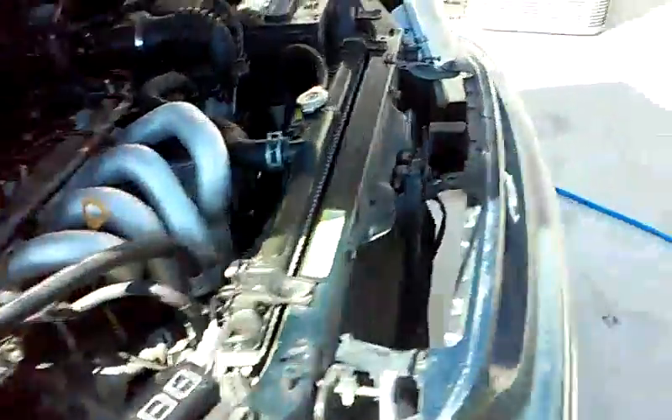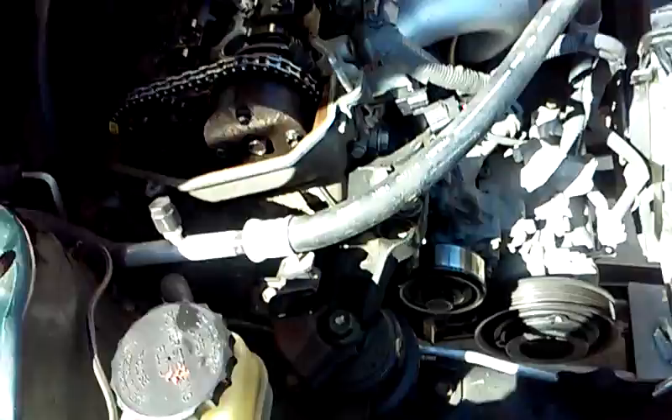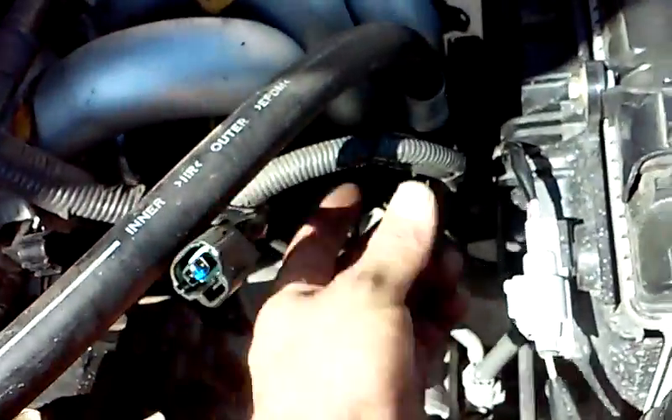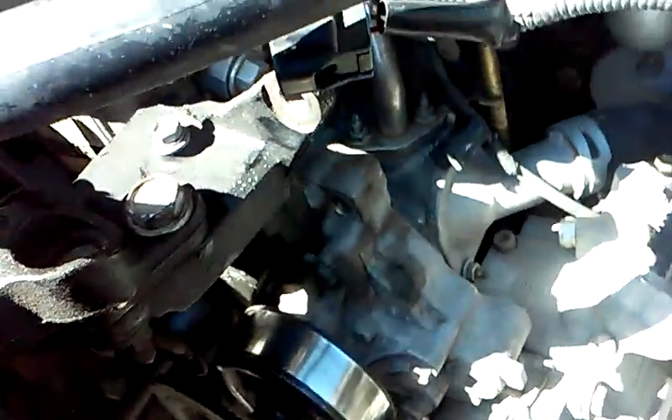Just to show you where I'm at now: right before removing my bracket, I decided to get my alternator out of the way because it is part of the bracket — that top bolt is right there. Using a 12 millimeter socket, I removed my alternator, got that unplugged, and set the wires aside. Before that, I also used a 19 millimeter socket — as you can see down there — and grabbed my tensioner, moved counterclockwise, and was able to remove my belt. Now with my alternator out of the way, you can see my water pump right here, which is going to be replaced.